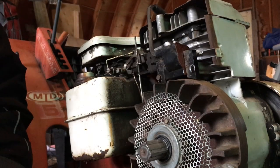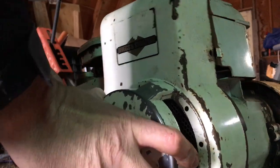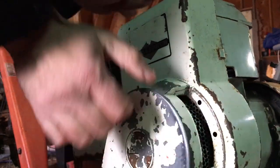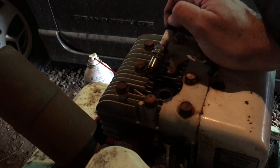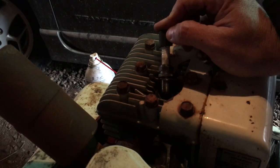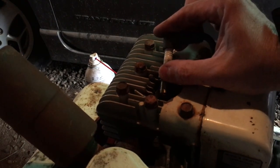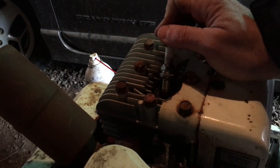Let me just slap the recoil on it and see how we do. After being frustrated with what's going on — maybe my ground isn't good against the bolt — that appears to be the issue. If I put this thing right up against the hole and press it firmly, not always, but I am getting spark out of it. It really wants to be seated in there, and I have been getting spark, so the coil system is working and I'm getting a moderate amount of ignition.